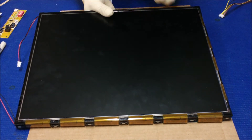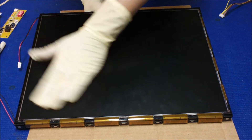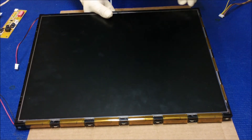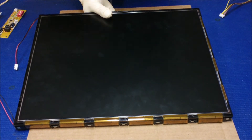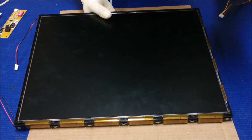This is a really important and tricky procedure. Make sure the glass is stuck inside the plastic frame. If even a little corner is off position and you try to push the metal frame together with the plastic, you're going to crack the corner and the screen is gone.